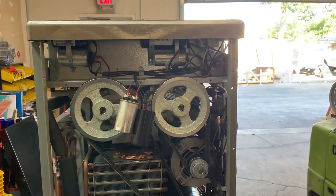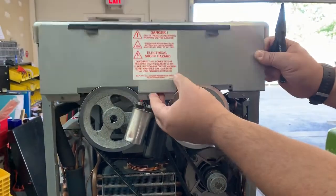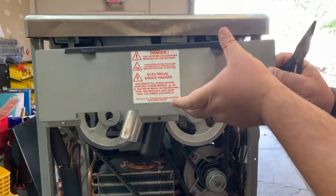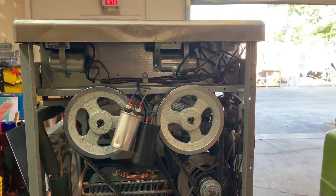I've got this panel that sits in the back of the machine — it sits on here like this. There are three five-sixteenths head screws on there that you need to take out. That just comes off and the capacitors are right in behind here.